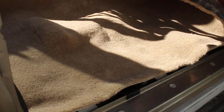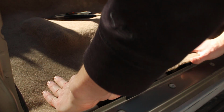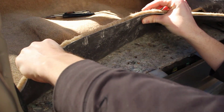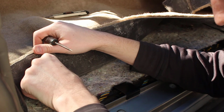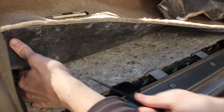The hole's a little bit bigger than I was hoping, but plenty of wiggle room. And whenever we put the seat bracket on, you won't even see it anyways, it'll get covered by the seat. So for these ones, we're just gonna repeat steps 1 and 2, or the ones that we just did. Lifting up the carpet, poking a hole, cutting it out with the blade. Should be pretty simple and straightforward, shouldn't take as long, especially since we can actually see where the hole's supposed to go. Just gonna mark a center point here, poke a hole, hole's been poked.